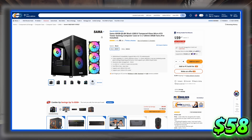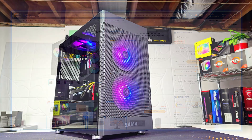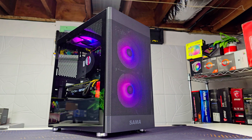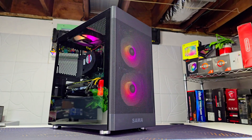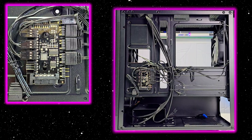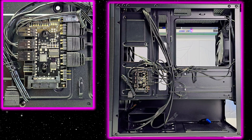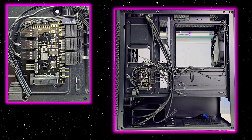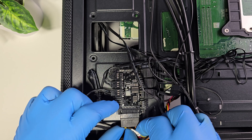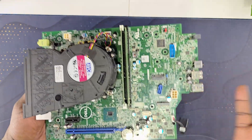The first thing you will need is your case. The case I went with is the SAMA ARGB Q5 — a lovely case. It's a micro-ATX compact case that comes with tempered glass and three beautiful ARGB fans. The best feature is that it comes with an ARGB fan controller on the back, because all we will need is to plug in power to make all our fans work, since this Dell motherboard does not come with any extra fan headers.